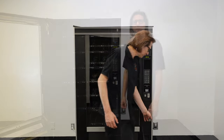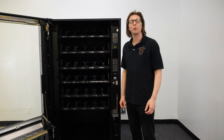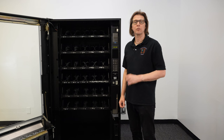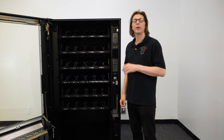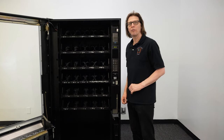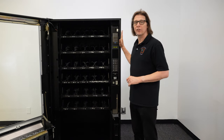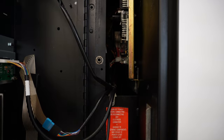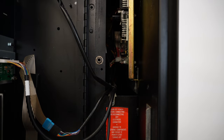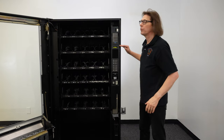The first thing we need to do is open the door on the machine. Once you've opened the main door, your next step is to press the service mode button, which can be found on the VMC control board. It's physically mounted to the control board, and it's typically a beige or yellow button. On a Crane National 147 and 148 snack machine, that board is located on the right-hand side wall of the machine behind the monetary door. Simply open up the monetary door and press the service mode button mounted on that panel. Press the button one time and the machine is now entered into service mode.